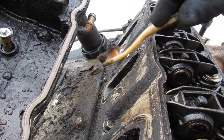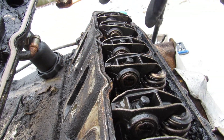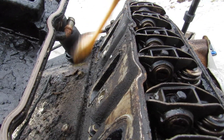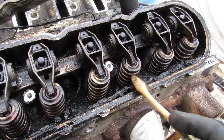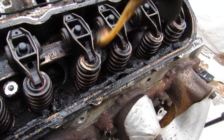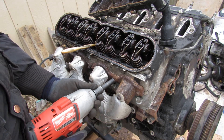By having a single camshaft that powers all eight cylinders and each of their valves, you can save a lot of space by not having a camshaft sitting on top of the engine — everything is buried inside, which makes this engine so compact. In addition, the spark plugs sit off to the side in the cylinder head as opposed to down in the middle like a lot of conventional engines.